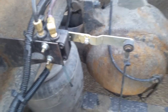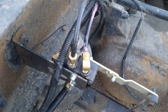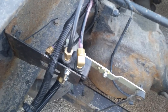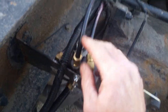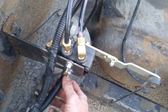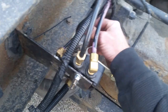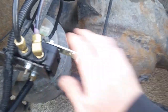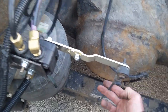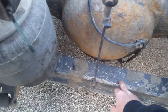You take this, and this is your inline right here. This is a Kenworth W900 '05. This is your inline. Here's an outline that goes to the airbag. On the bottom is another outline that goes to the airbag. Here's your dump valve. This here is the leveling arm, and here's your rod that goes down to the crossmember.